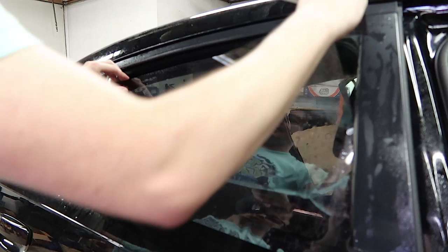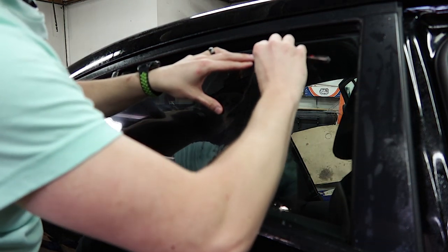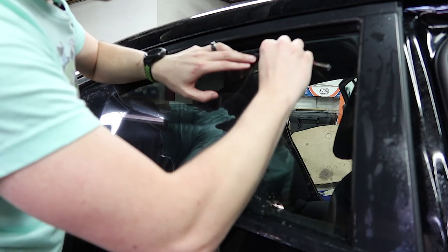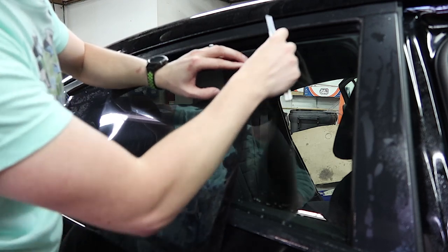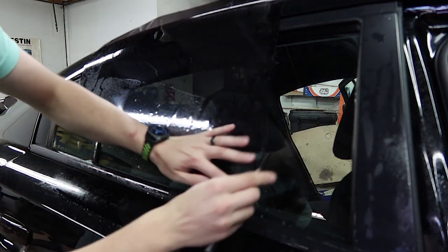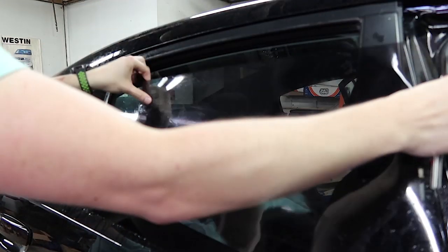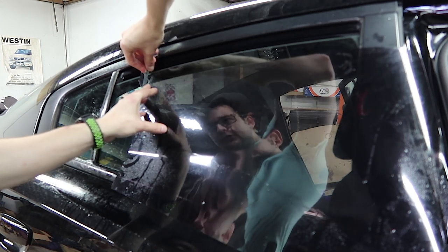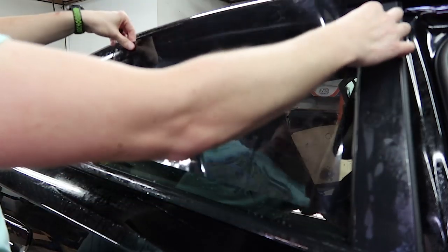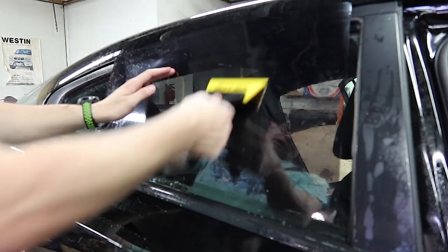Tear away, and now it's a matter of playing connect the dots to round the corners. We're already really close to the sides with this top part but a little bit farther away from the bottom. If it's a little bit off, it's not really that big of a deal — all the cuts going into the sides are hidden, so if you're a little farther out one way or the other, it's going to be hidden. Then we just want to round our corners a little bit. I'll usually go up the long trailing edge and then deal with the top. That's all cut now — we leave an edge on the top and the side, squeegee that down, and it's all ready for shrinking.